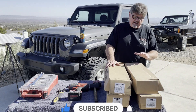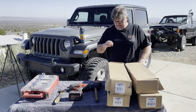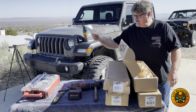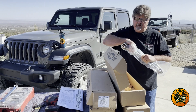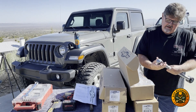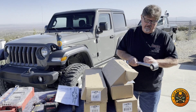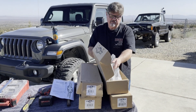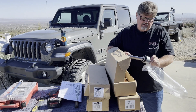The top ones are the front upper and rear upper, and the bottoms are the rear lower and front lower, so the lower arms are longer. These are the Rubicon Express. We have some directions here. The arms have a super flex joint here. This part goes up to the frame rail and this is a jam nut — it's an inch and a half. These are the rear uppers, there are two sets, and the kit does come with Zerk fittings that we have to install.